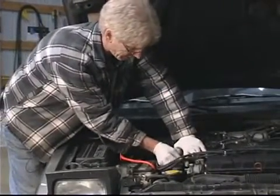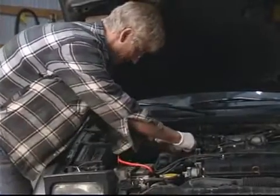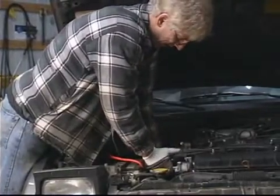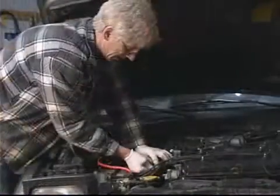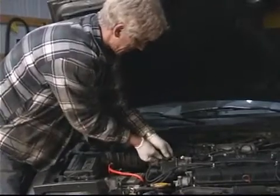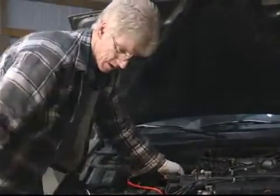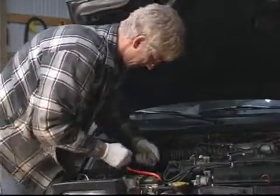So I'll stick the first one in and start it by hand. The other top one. And that bottom one, it's kind of hard to get to it sometimes. It can be a little frustrating, just be patient. And I just want to continue tightening those down by hand. And once I get them snugged up, I'll just give them an extra turn with the ratchet.